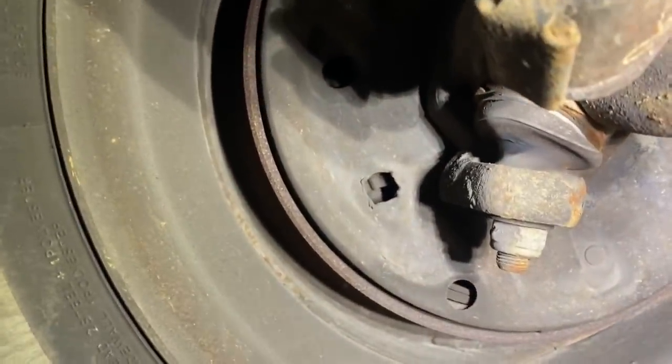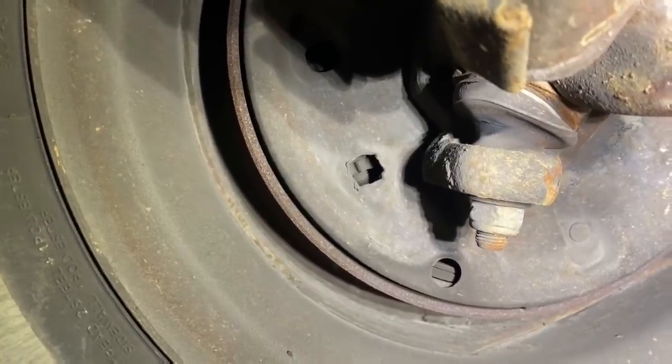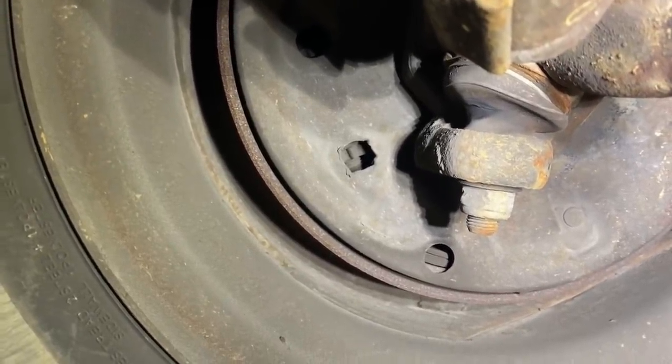Adjusting these front brakes on this Volkswagen, there's these little dust shields inside. There's two little holes there, and inside those holes there's little sprockets or stars, I don't know what people call them, and that's how you adjust your brakes. So you adjust them and they go opposite directions too. You expand the shoes until they just start dragging on the drum, and then back them off a notch or two. You'll just barely hear them rubbing. You don't want too much tension on them.